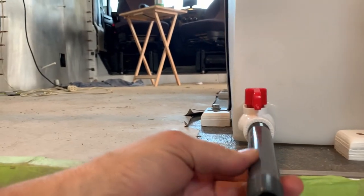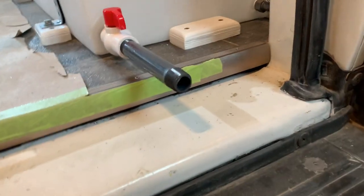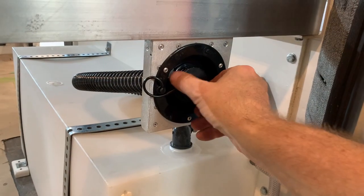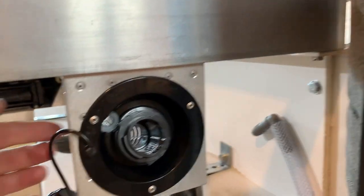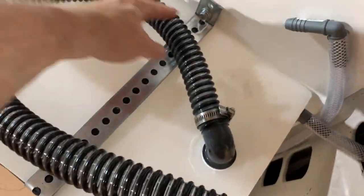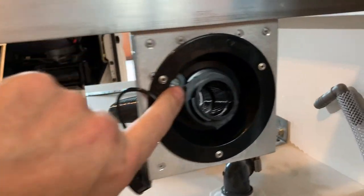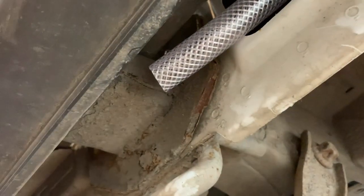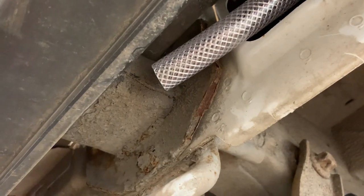For that purpose, I would probably in the fall just quickly thread in a little extension like this. Then you can drain the tank and it will just be pouring straight out the back of the van. What I like about this is at no time are you perforating the side of the van — just open the back door and you can drain the tank. Here is the fill right here. There is a vent line connection right here which I am not using in the traditional way. You can see that the water line just goes straight into the top of the tank, and the vent line I am connecting goes straight into the back of the Ram ProMaster. Underneath the van, there is your vent line just in behind the bumper — meaning any sloshing, the water will be coming outside the vehicle rather than inside the van.